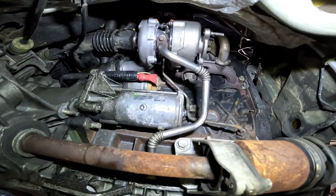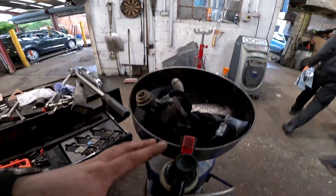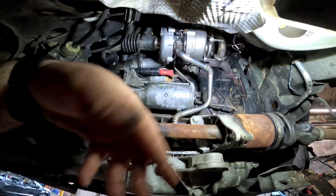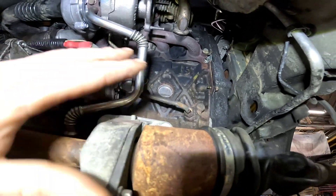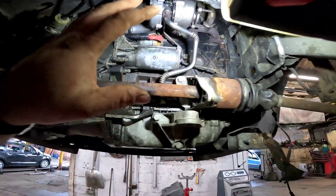Right, let's get this back on the vehicle. There we go — that is one turbo now all back in place and everything's torqued to spec. What I like to do when I've fitted them is get your brake and clutch cleaner and just give the turbo a bit of a clean down, because when you start it up you're not getting that oily burny smell off it. As you can see I've washed everything else down with brake and clutch cleaner and it is nice and spotless.